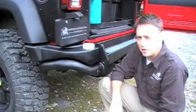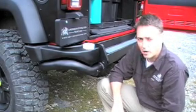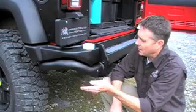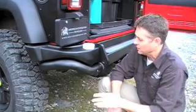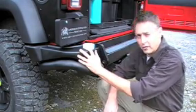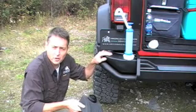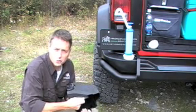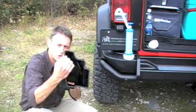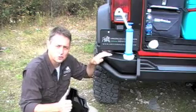One of the particularly interesting aspects of AEV's rear bumper are these twin 2.3-gallon water tanks. For anybody who's done a lot of long-distance off-road trips, you know that adequate water supply is a real challenge and storing it is particularly difficult. AEV realized that all bumpers have a lot of dead space in them, so we've made use of that dead space by employing these two tanks on either side of the bumper. The tanks are constructed from strong cross-linked polyethylene — the same material used to construct whitewater kayaks. Looking at a section cut in half, you can see it's actually over a quarter of an inch thick in a lot of places — incredibly sturdy material, so even without the steel protecting it, it could still take a hit.